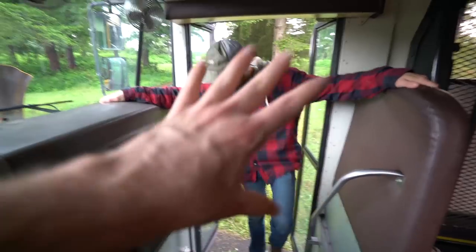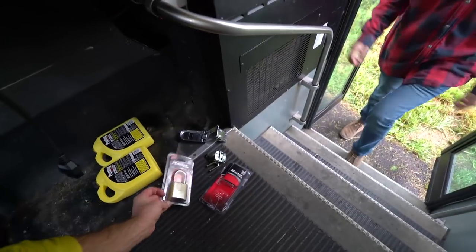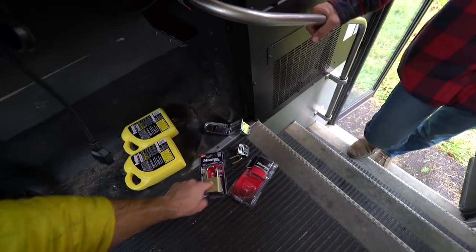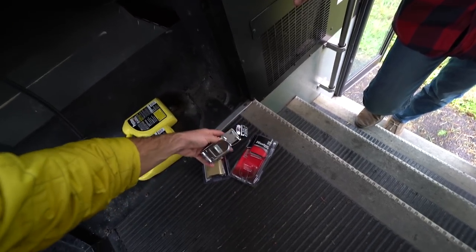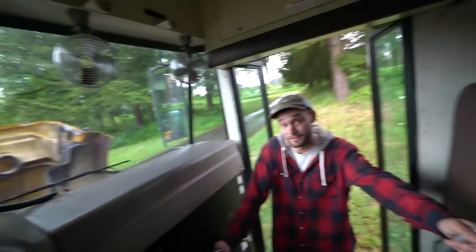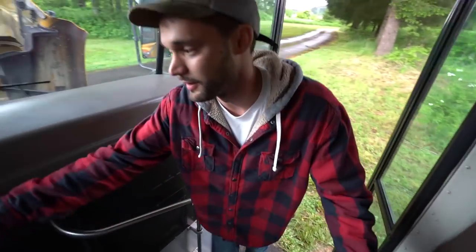There is no front locking mechanism, so Michael suggested adding a simple combination lock with a latch across the bottom. If you're inside the bus, you can also put locks on the inside. On my own bus, I leave the door on manual and turn the air lock on — the air tanks hold pressure overnight, so the doors are actually held closed by air rather than a physical locking system.